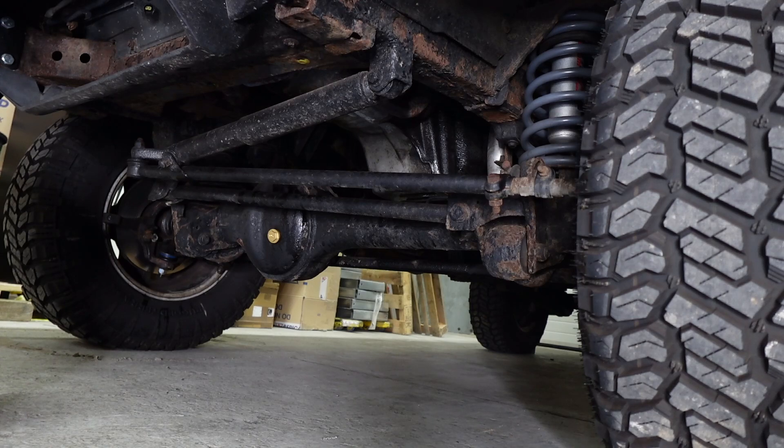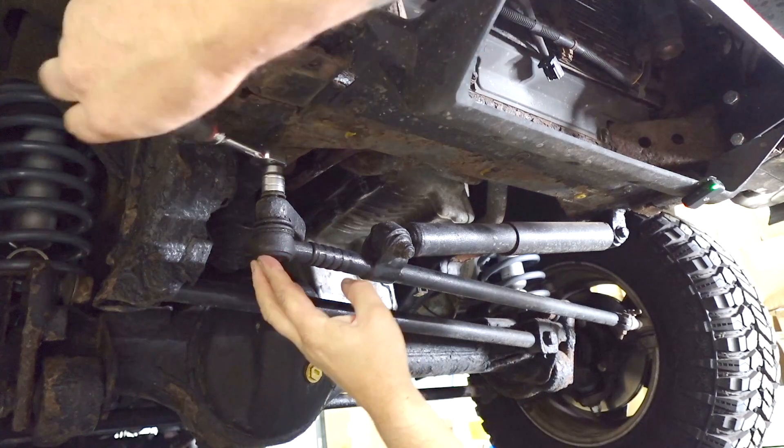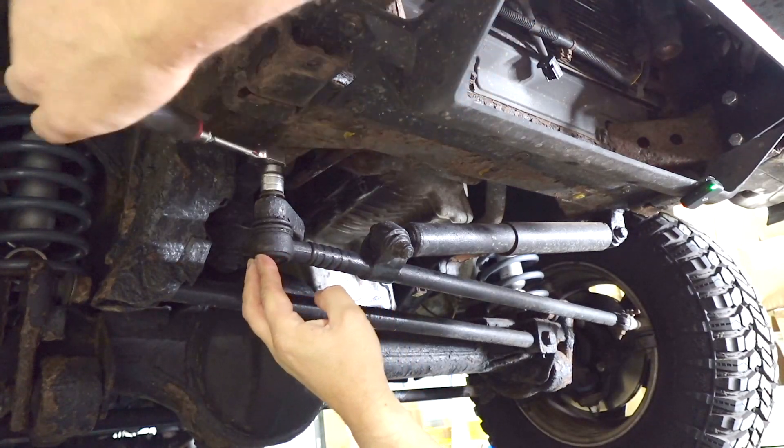The trick on this is to get everything to be the same length when we put it back on the vehicle, so we're going to have to measure and get that right. The vehicle will have to be tracked obviously, but the closer we can get it visually the easier the job will be. We'll try these ball joints first and see what they're like to remove - we'll get some penetrating oil on there first. That cracked off nice and easily.